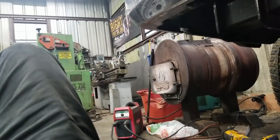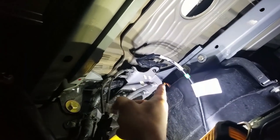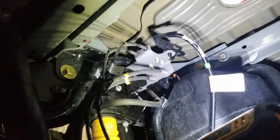I'm going to crawl underneath here and see what we did. So we've got some of the brackets in there. There's a bracket that goes over there, bracket there, and you've got this beam that connects across. You've got that one over there. So we've got it all bolted in and all torqued down — the smaller bolts are 100 foot-pounds and the bigger bolts are 150.